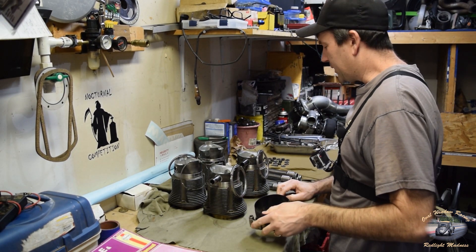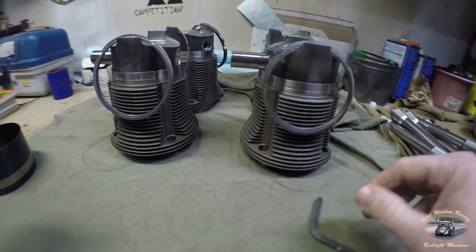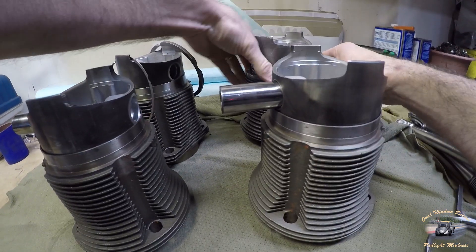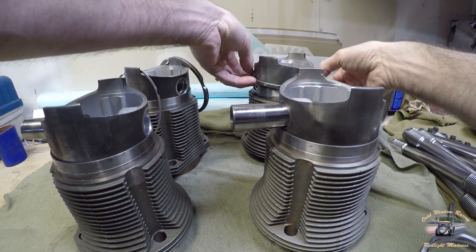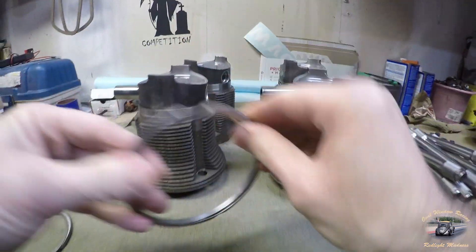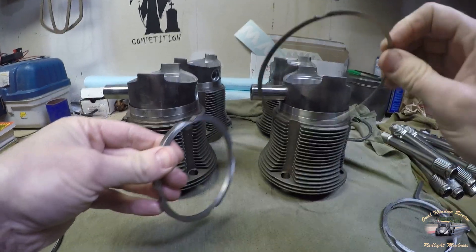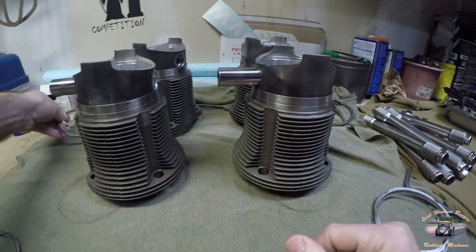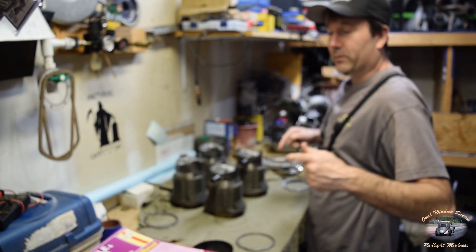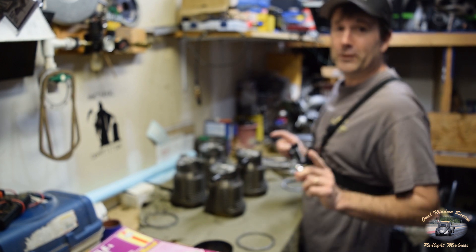We'll move on and I'll show you how I do this. I'll move the tubes out of the way and try to move my shims without messing those up. I got down to using just two shims, and if I get brave enough in the future I may just get rid of this one too and run really high compression — but that's for a future build. If I can't make 11 seconds with what I've got here, then we go to extreme measures, and those extreme measures will be heading for 10 seconds.